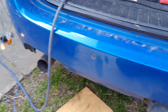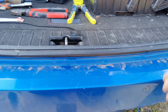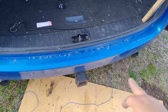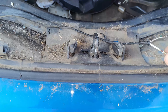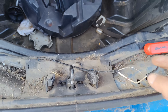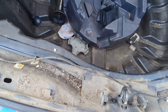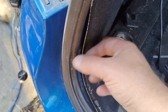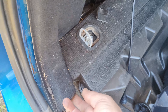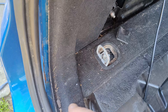I've got to take everything out now because I want to come up into the car, possibly running from that light there across rather than coming up from underneath — we'll see what happens. I forgot to mention, there was no wire going from there down to there. What I've learned so far is that the white wire is definitely earth — that's generally the normal wiring for a trailer, the white wire is earth. There's a little grey wire, however, it is joining down underneath there but there's no power on it. Following it across over here, behind here, I think I'm going to find something behind there — that's where the problem is. So I need to remove this panel and see if that's enough to pull it forward, otherwise I'll have to take the whole panel out to get access. Hopefully just by removing this I can get access behind there.